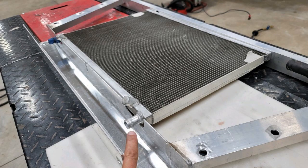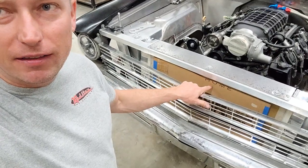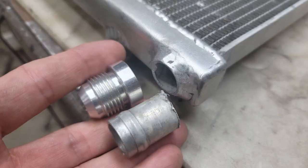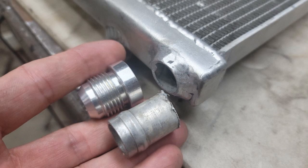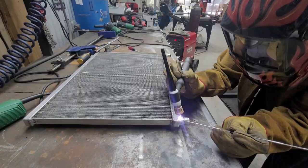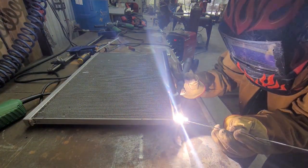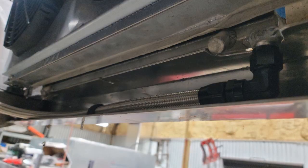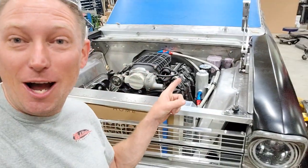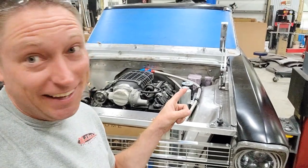The heat exchanger that I took out of the 2010 Camaro donor car — which is right there, being covered up by some cardboard — had these rubber hose slip-on connections where you would use a hose clamp to connect your hoses to that heat exchanger. So what I did was I cut those off, as you can see in this shot right here, and then I welded on some male 10AN threaded bungs. The welds turned out way better there. And I absolutely love that I have nice looking welds on the bottom of the car where you'd have to get on a creeper to actually see those — but the ones that are right up top, front and center, where you'll see when you open the hood, they look like shit.